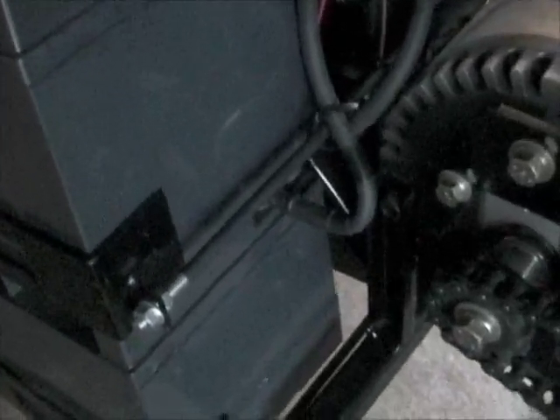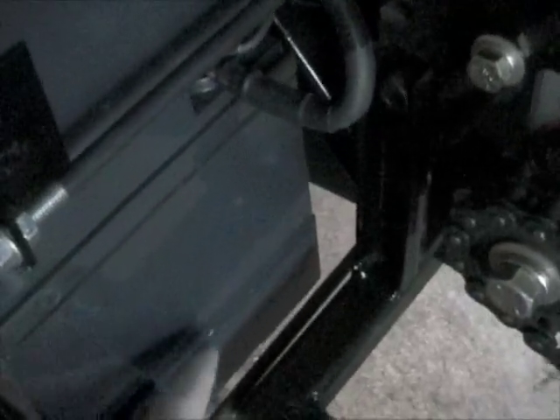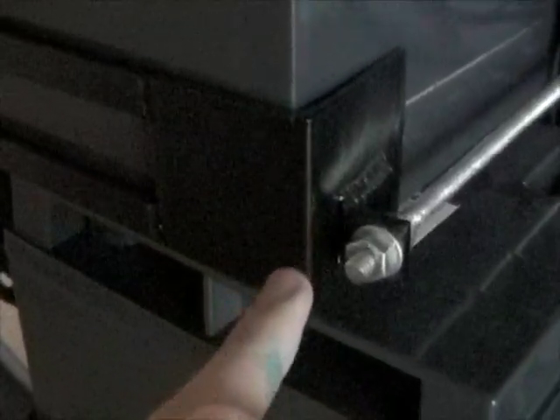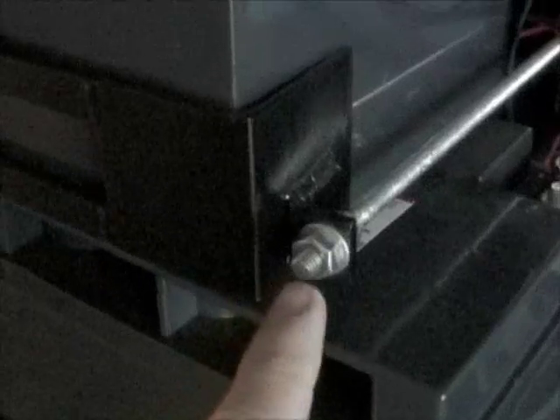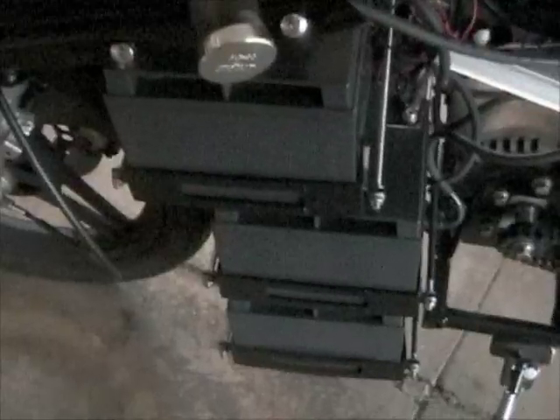The batteries are held up essentially by a clamping force. You can see here this is the inside L bracket — those are just bought at a local hardware store and run along the length of the inside of the battery. On the outside, these were a little trickier because they were custom made — it took a considerable amount of work to make six of these. The batteries are then clamped together, with the clamping force provided by a threaded rod on the front and back. There are six batteries total in series creating 72 volts.